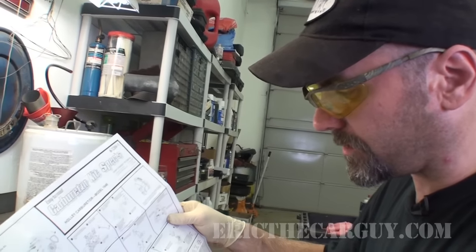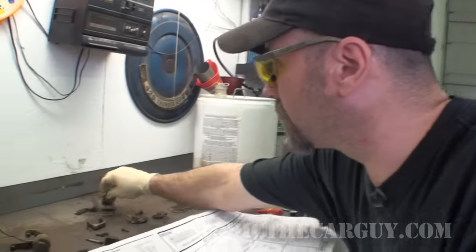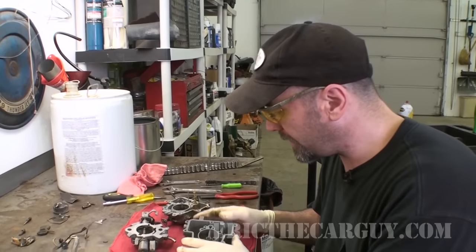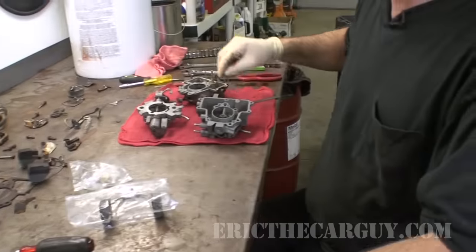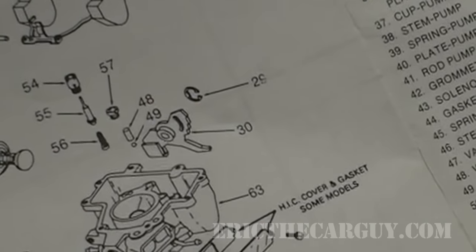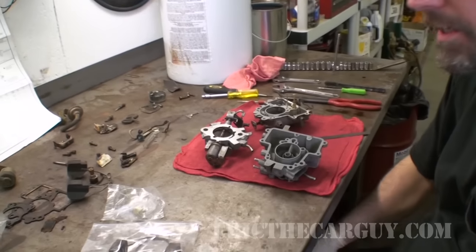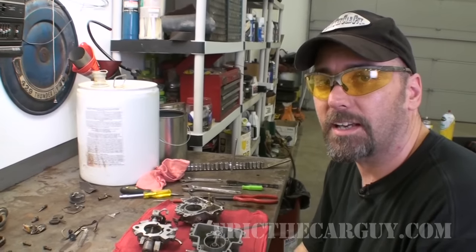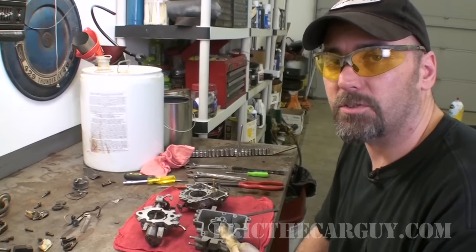Let's find out what that unknown piece was — it's a hot idle valve, a thermal valve that puts a little more air in to keep you from running rich. This here is the choke pull-off. Looks like we're going to start with the float level adjustment. Now about the check balls — parts 48 and 49 on the exploded view are the check valve for the accelerator pump. When I disassembled this, I didn't see any ball come out, and I even mentioned how odd it seemed that there weren't any check balls, because the accelerator pump normally uses a check valve.